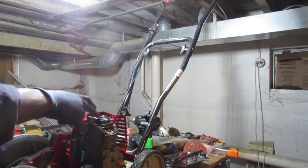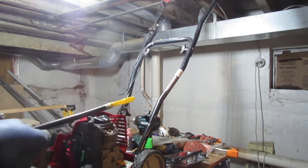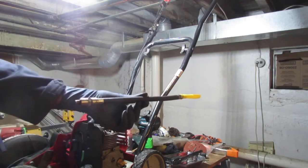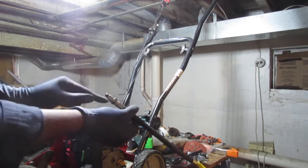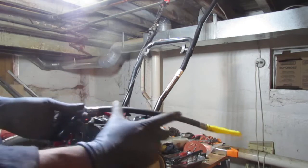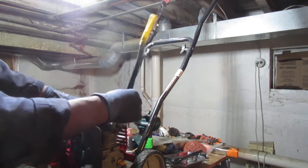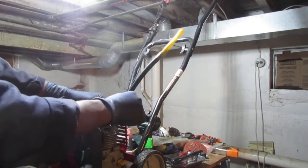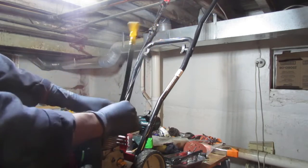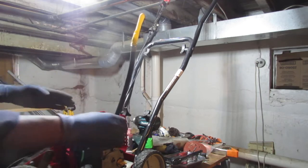Right, so we get to do this valve clearance, right? You want to do this when the engine's cold. And I got these parts from my OTC compression, deluxe compression set. This is the M10 adapter right here. And then I just attach this part to it, and I put a balloon at the end. What I'm trying to do is, when the balloon blows up, that means I'm on the compression stroke. And you can see it just by opening it up, and you can tell from watching the valves, you know. But this is one way to make sure you don't mess up.